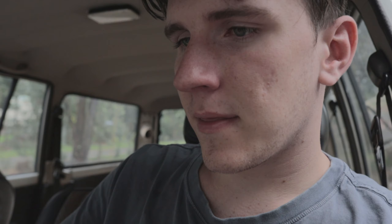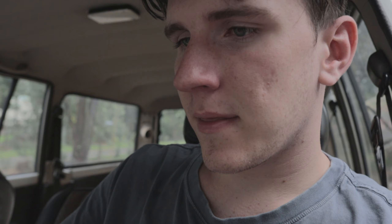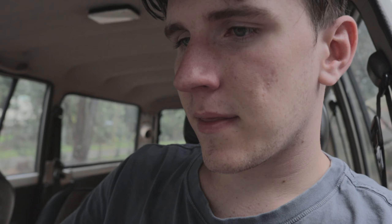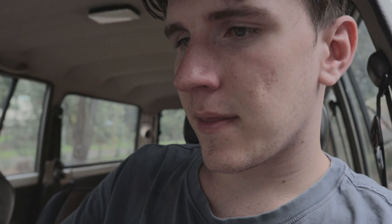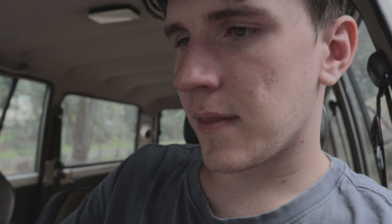The dash is the one part that is really bad — it's basically ripped up — but I'm sure I can find a replacement from somewhere. Got a tow ball, which is a good selling point. I'm going to try to get a rear wheel carrier since you can pick up parts pretty cheap for these 60 series. Where we start getting into it is the roof rust, which every single 60 series has. This one is actually not quite as bad as I thought. It all has to be cut and sandblasted underneath — it's usually roof racks that do it. Everything else just seems like surface rust, nothing really bad. There are also a few rips in the floor. It's a manual, five speed.